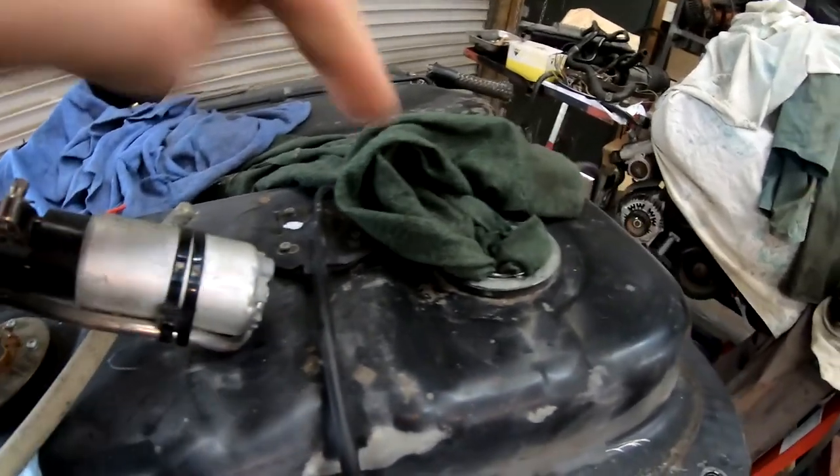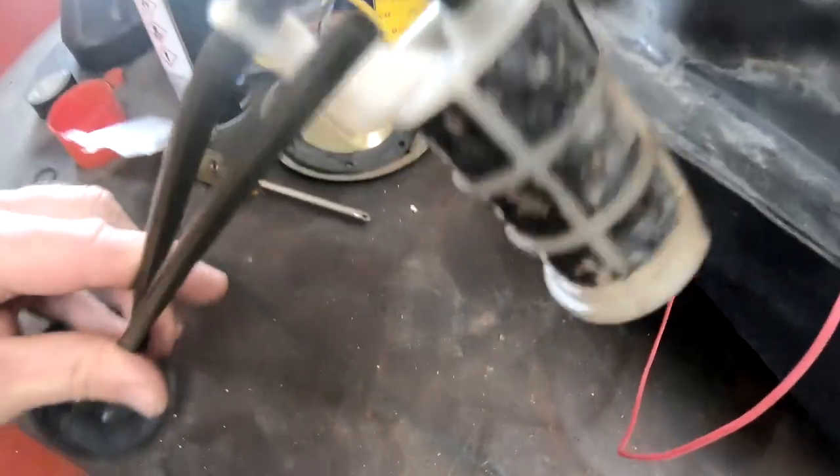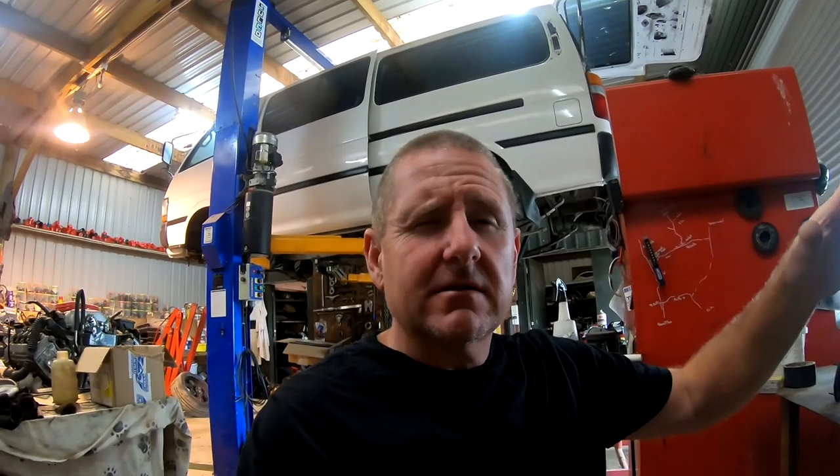In the fuel tank department, we were going to put a fuel pump into the diesel tank — nice and simple easy job. But I've managed to find an injected petrol tank for this job. If you can, it's easier to just buy the right parts. A stock-standard HiAce EFI tank out of the later model — 2001 to 2003 before they changed shape — is way easier to put in: the tank fits better, less chance of leaks, the pump fits in nicer in its proper cradle.